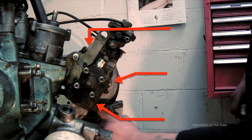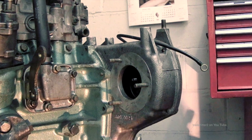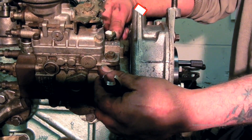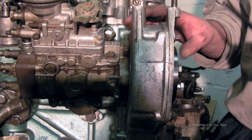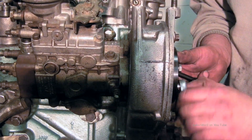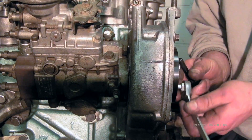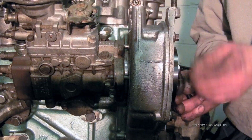With the pump timed up, there are three flange bolts holding the pump onto the timing case at the rear. Undo those — they're 13mm nuts, though they may differ depending on who fitted the pump previously. The top one nearest the engine block is probably the worst to get off. Once done, withdraw the timing pin as it won't fit through the support tool. Then nip the support bolts in — as I said earlier, not all the way in — and they'll push the injection pump out, leaving the pulley in place with the belt attached and fixed solid.